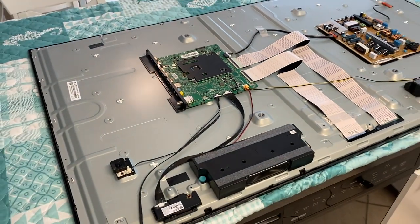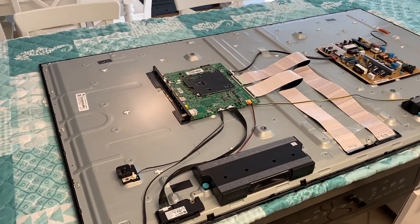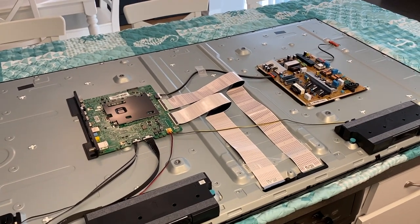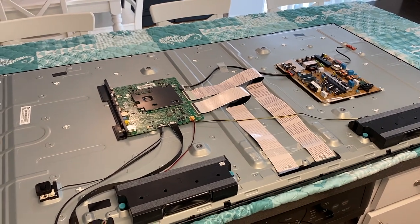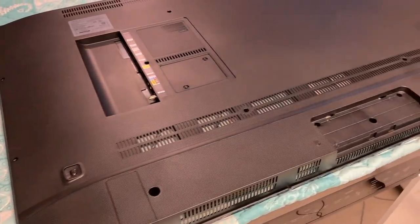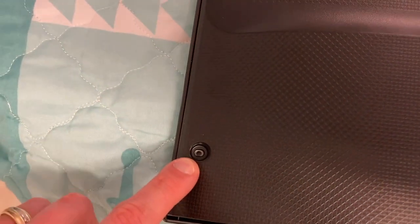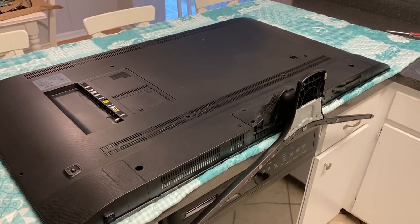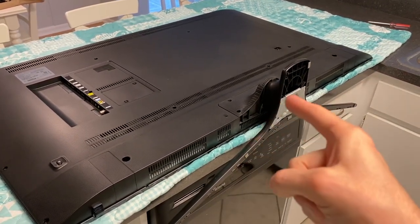That's all it takes to replace your speakers. From here, take a couple minutes, inspect everything, make sure everything's good to go. Go grab that back panel, align it properly, and as you align that panel in place, make sure you do it carefully so you do not damage anything in the process. Re-secure all of those Phillips screws as well as your mount or base. Once the back panel is rested in place, before you start inserting screws, make sure all the screw holes are visible the entire way around the TV. Do your best not to over-tighten them — you'll run into cracking plastic. Insert and secure the base as well.